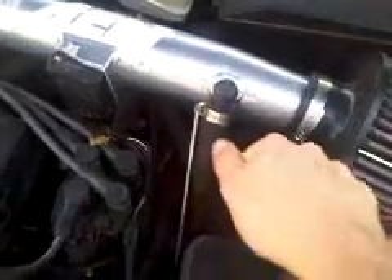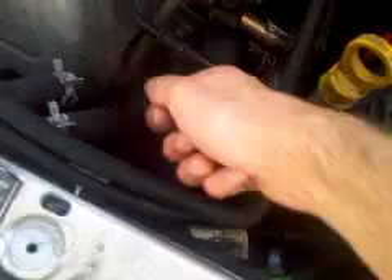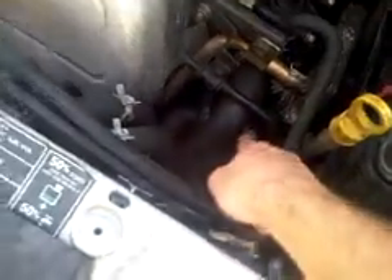I'm going to be able to wire it all up. I found out where I'm going to hook it up — it's a little weird since I'm not the biggest car person. While testing it, I unhooked the PCV here, which goes from here to the air intake. The PCV valve on my car is right down here — I replaced it not too long ago. I'm going to tee it off right here for the HHO out, which goes into the bottom of the throttle body.